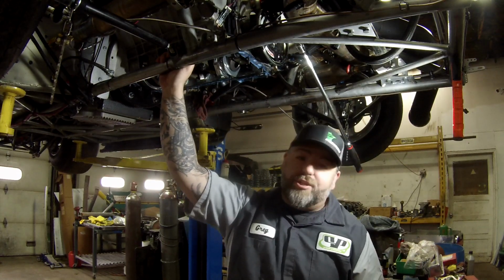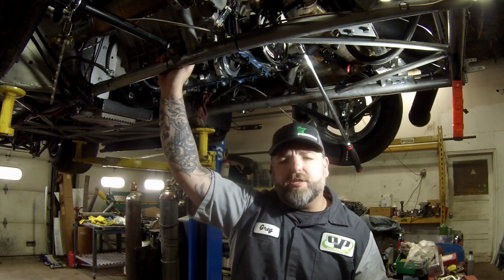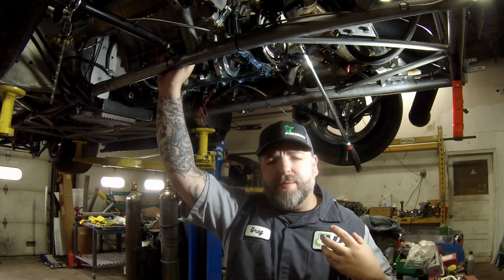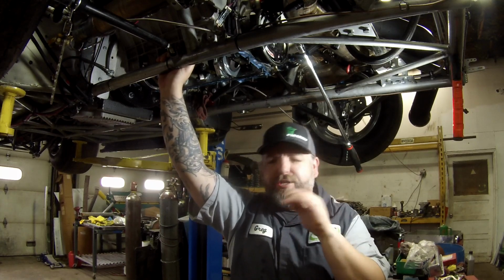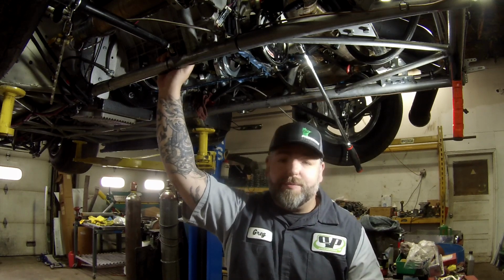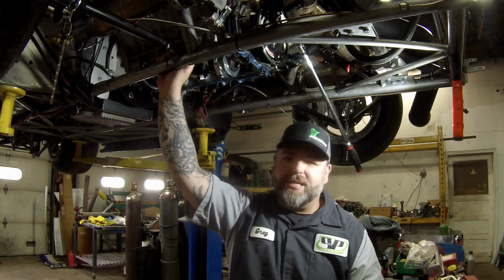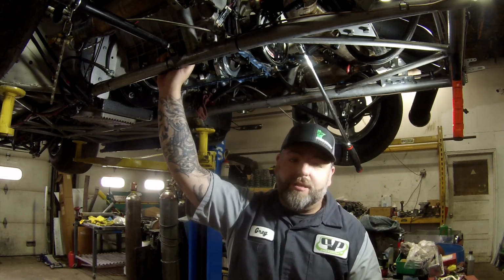We got all the rods checked. Everything looked the same, besides from when we did that initial startup and had a bunch of the methanol in the bottom there, where it roughed the bearings up a little bit and took some of the top coating off, which is completely fine in this. We have some pretty big rod clearances on here, so that oil gets up in there and stays good. But that's why we want to just double check everything.